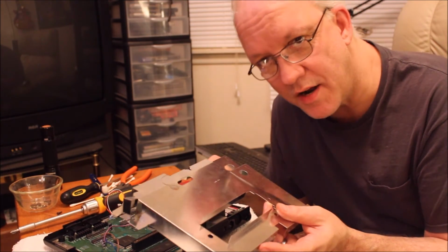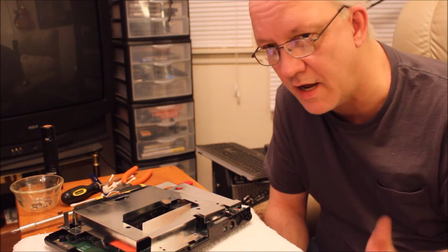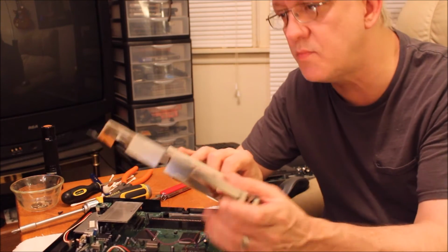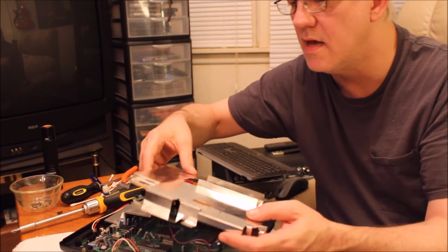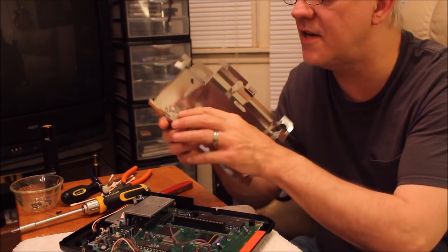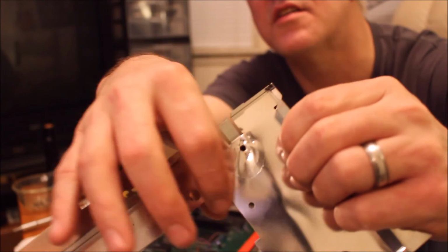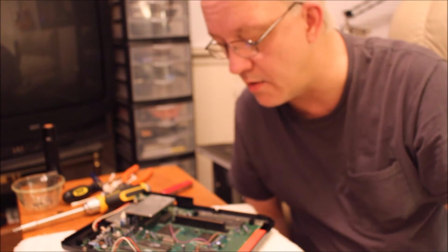Yeah, that was bad. I watched a video in between the time I did this video and the last video. I may segment it, I might just put them on its own, but the last part before this one, where he said to go ahead and after you get all the screws out, gently pull it out that way, which makes sense because it's got a lip here where it closes on, and it's got a little sink here, so that makes sense. But it didn't work that well for me because, unlike him, I had a ton of glue underneath here. As you can tell, look at this. I didn't clean the RF shield up on the bottom side. There's a bunch of blue. Let's see if you can see that. Blue glue that just seeped through and made it just impossible to remove. So I had to do it that way.